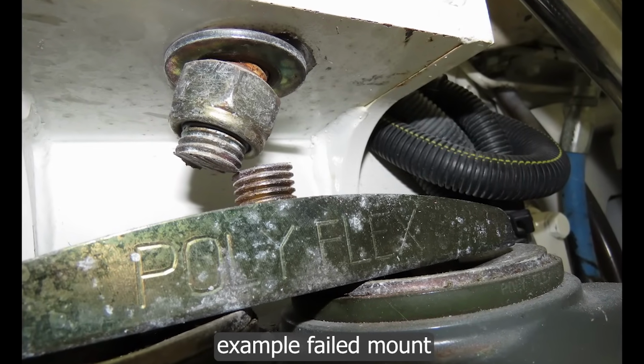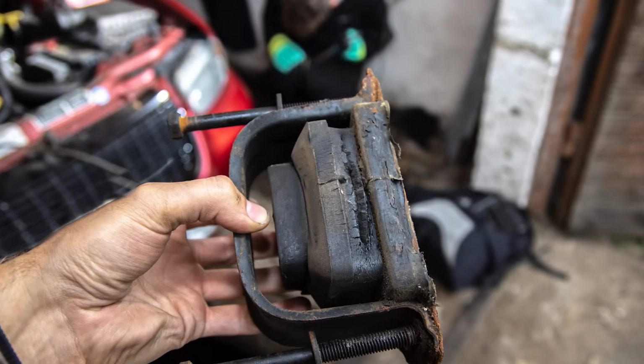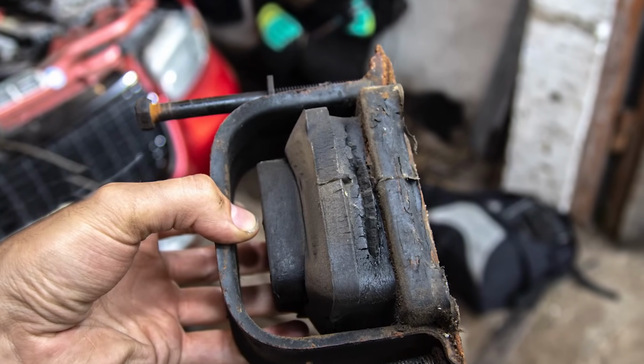It was either caused by poor shaft alignment, which turned out not to be the case, or something else was causing the issue. While inspecting the engine mounts, the most likely culprits, I noticed the rear port side engine mount was leaving a lot of rubber dust and residue around itself. With the engine stopped, I was able to actually move or twist the mount by hand. These are telltale signs of engine mount wear, and in the case of that particular mount, a possible and imminent mount failure, which is the last thing any of us would want.